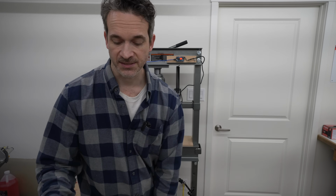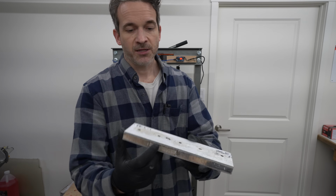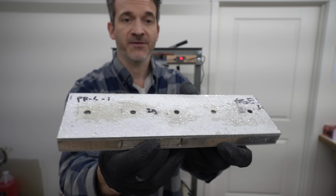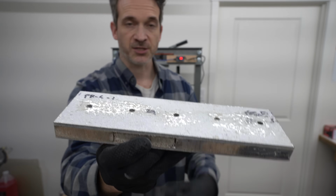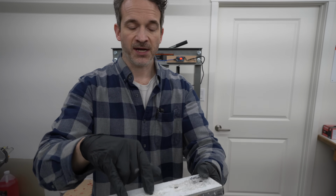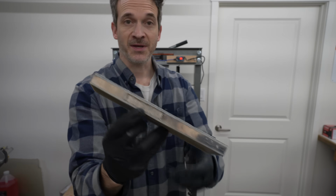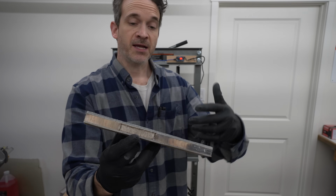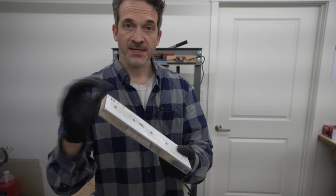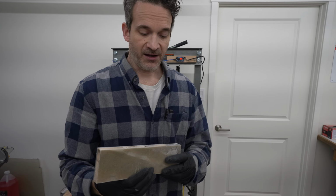One thing I noticed is that because the balsa rots in a rather unpredictable manner, there was one area here that you can see is still rather soft to the touch, even though it was right next to 2 injection ports or holes. I didn't force it through, I just injected the epoxy until it wouldn't flow anymore, and nothing managed to get its way to this spot. Likely there would be holes on this side that would have filled that, but when you can't see the core, you don't really know where the epoxy is going. You're just sort of going with some blind faith.